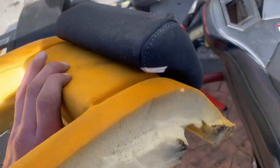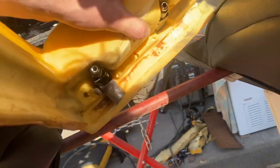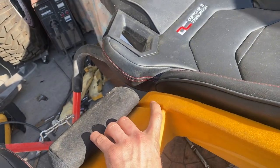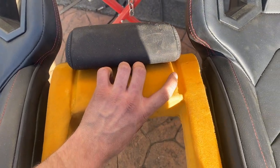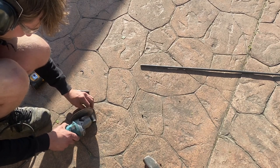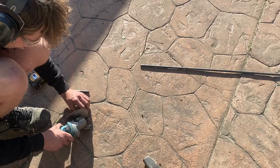This is a headrest from the Subaru and the spacing doesn't line up quite right. So I'm just going to weld a little tube in between those to get the right spacing and then just round it to fit on the bar so it fits a lot nicer. I'll be covering this headrest in vinyl anyway and I'm most likely going to be getting new foam, so I'll just cut these up. They're little tubes — I've already done one, this is the second one. I didn't video welding them in but you'll see them welded when I move on to the backrest.